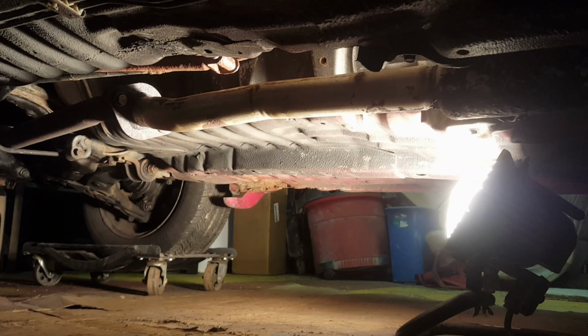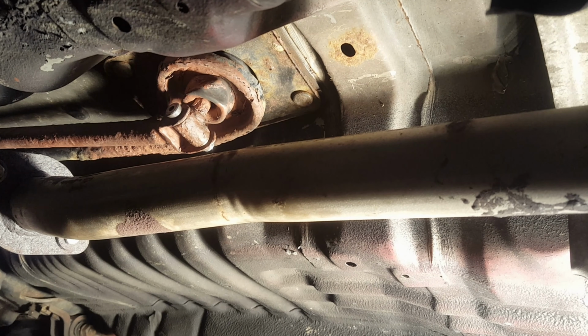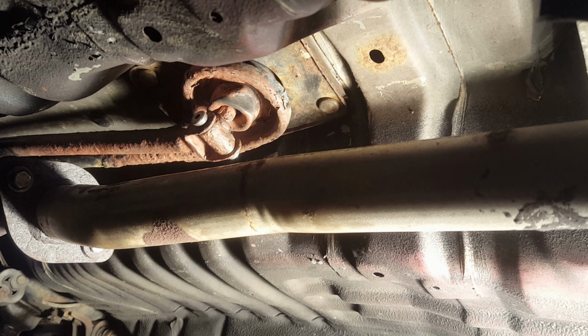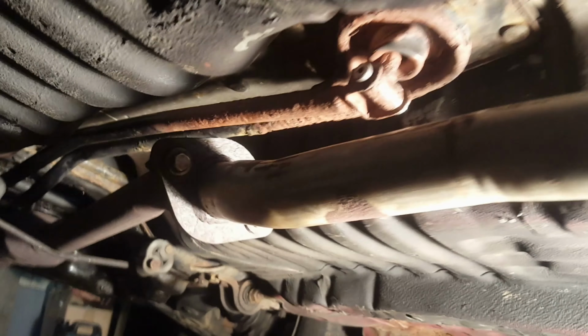Now that will allow me to grab the bar. Let's shift it back and up there. Now that's where that needs to be. Washer goes on. So back under the car we are. As you can see, that is the shifter end. The shifter plate is loose to the tunnel portion inside the car. And the reason for that is that the distance that the shifter center is placed from the transmission at the other end is set by the one rod. That rod there.